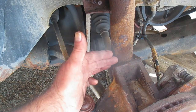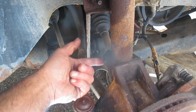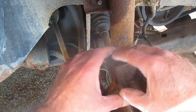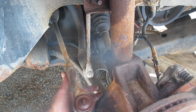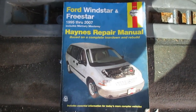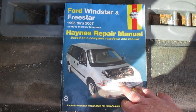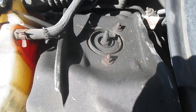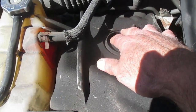The design of this strut has a pinch bolt on the steering knuckle. Here's the steering knuckle — you can see the pinch bolt in here. There is another configuration of strut assembly that is one piece with a horseshoe shape on the end that bolts down into the lower control arm. If you're replacing front struts on a car, you're going to have an easier time accessing the bolts at the top of the strut.